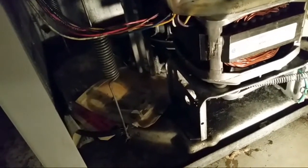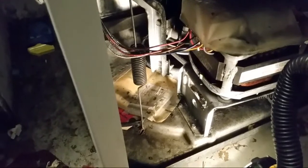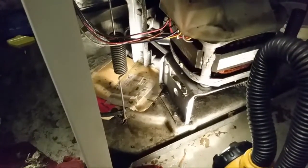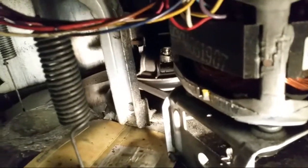Someone's saying sock in the pump — sock in the well. No, it drains — that's not the problem, it drains fine. Arnold, the motor actually reverses. I thought it was the electronics, but the motor does reverse. It's the mechanism under here that's the problem.